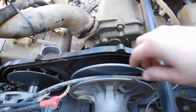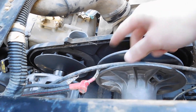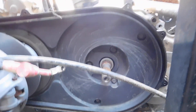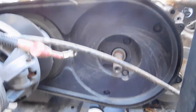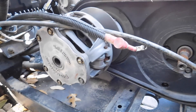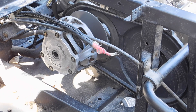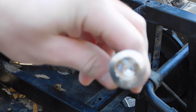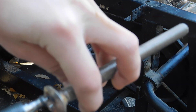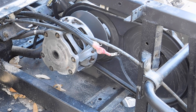The problem we've run into now is these bolts have to come out but the shield's in the way, so we're going to have to take this off anyways to slide these out. Now that part of the torque converter's off, we're going to zip out these bolts so we can hopefully just bend it back and pull them off. We're going to reattempt pulling this — here's the puller and here's the bolt we kind of threw together so it will sit inside of here. We're going to try to see if it works again because we're going to have to take this off to get that plastic off.